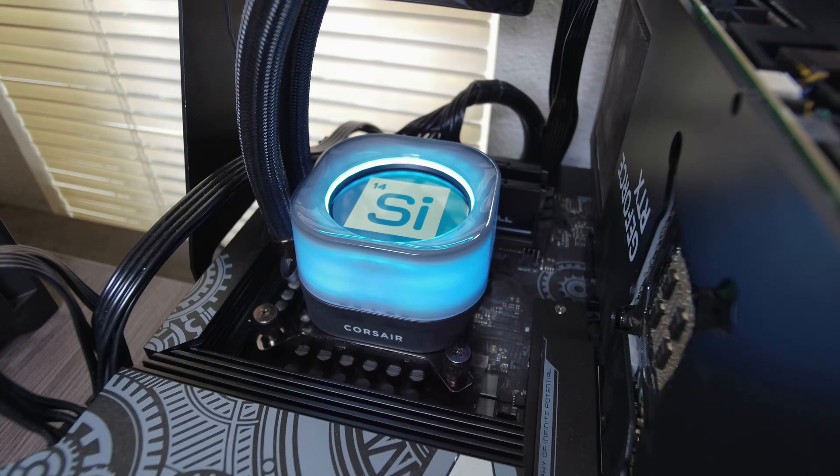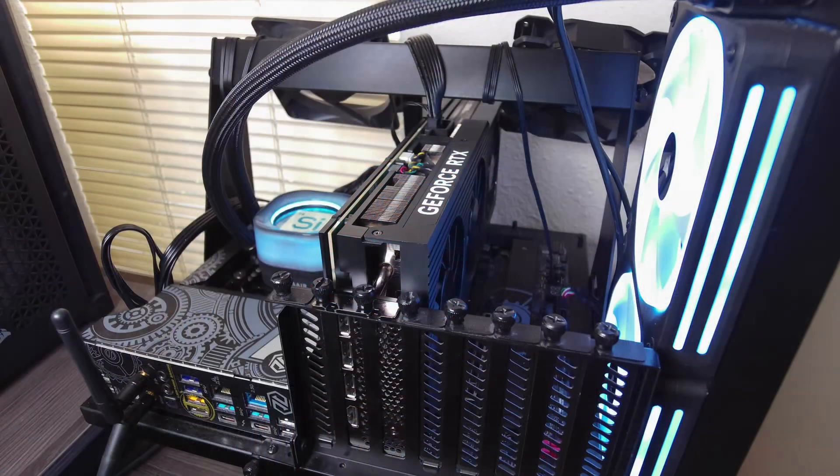Just as a side note, installing this cooler was really annoying. Our H170i requires us to install a custom backplate onto our motherboards, and we needed to remove this backplate every time we switched to the stock cooler. The stock cooler needs no screws — instead it has tool-less pegs that you push into the holes on the motherboard. This works fine for the first installation, but these pegs are made of plastic and get worn down with each installation. Eventually I had to use a screwdriver to get enough force to push them through correctly.